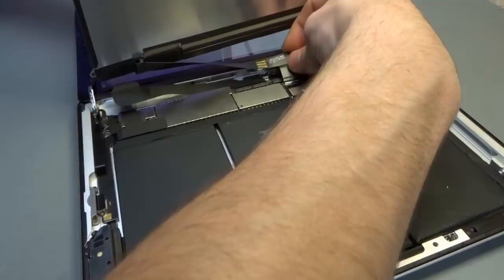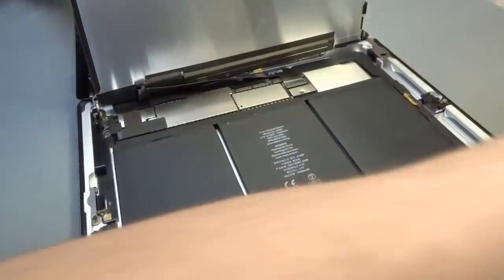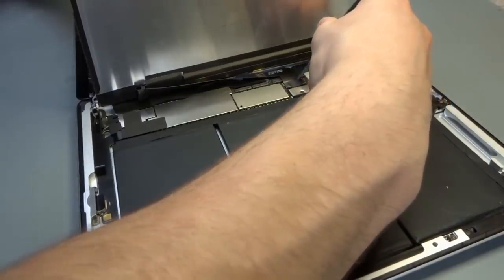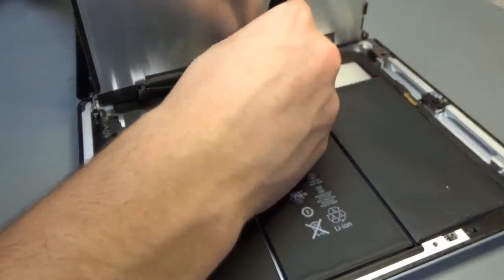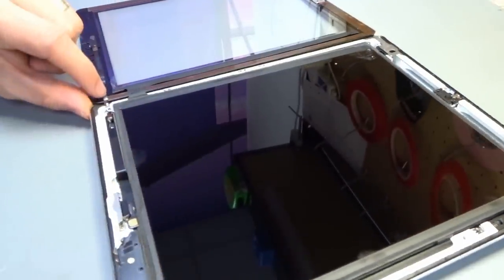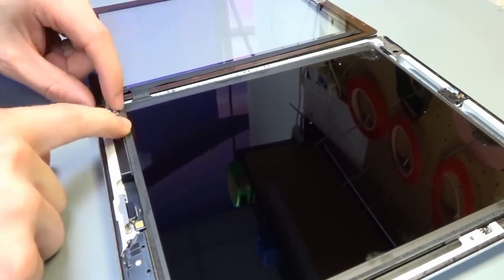Any adhesive on the back just sticks gently to what's underneath it. Then we're going to put back those little bits of tape that we saved — we peeled them off and cut them on the edge of the screw tray so they didn't lose adhesive. Put them back where they should be. If it came out of it, it should go back into it. Gently mind the home button cable — make sure that's out of the way before the LCD gets pushed in. Make sure it's in place, top and bottom, corners nicely pressed in, no bungee cables that are going to break. If you have to force something, there's a problem.